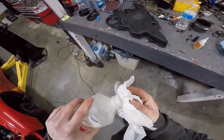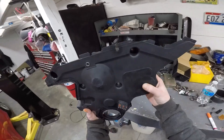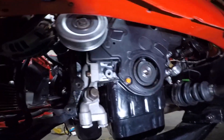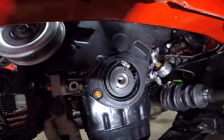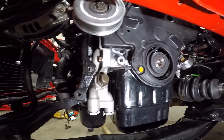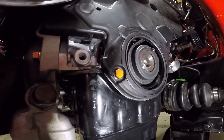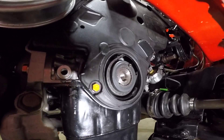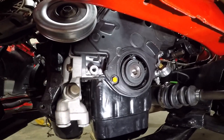Just wipe it off with some alcohol — paint marker sticks real good, that should be a little bit better to see. When I'm putting this timing cover on, you'll see how that one bolt is orange. I painted it orange because there's one bolt on this whole timing cover that's shorter than all the others. If you put any other bolt there, it'll hit your crank pulley and you'll crack your crank pulley. I did that in a video a long time ago — that's how I know.